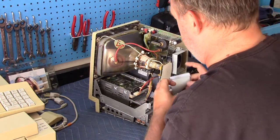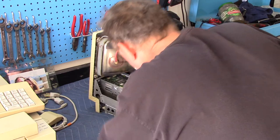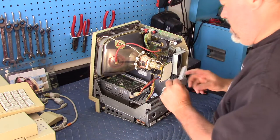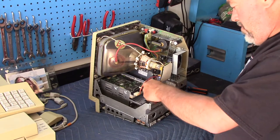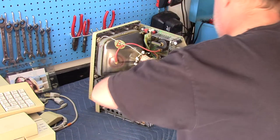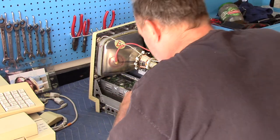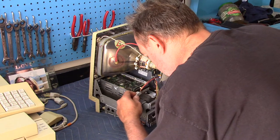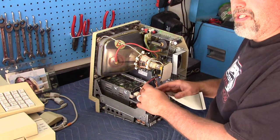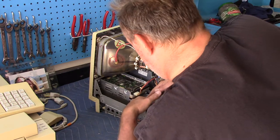I have my SCSI adapter there. Pull that out for just a minute. Make sure it's down. Okay. Sound is still on. We'll put our power back to the motherboard. Floppy drive. And kind of cool is there's an upper and a lower, and you just read for it. So this is our lower drive, so it needs to go into the lower drive socket, which is closest to the front.